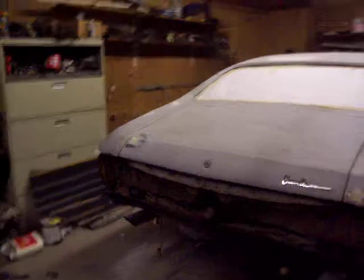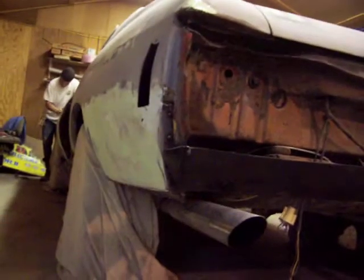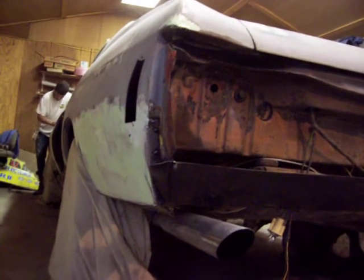We're getting there and I got most of the jam stripped off. It's taking a little time, a lot of hard work, but it's coming on out. My quarter panel is getting pretty straight there, and this over here is too. It had a lot of waves in it — when they welded it, they got too hot and it really buckled it, but that got smoothed out.